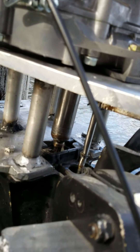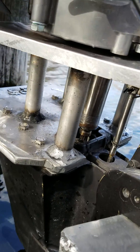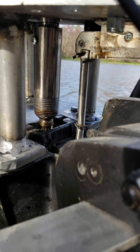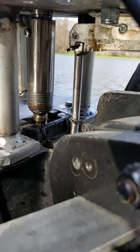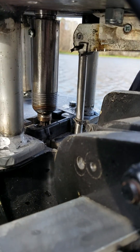It has not skipped a beat. As far as locking it in place, I used a 3/16 inch machine screw threaded into the keyway. I'm probably going to be putting a second one in there just for reinforcement, but that worked very well.